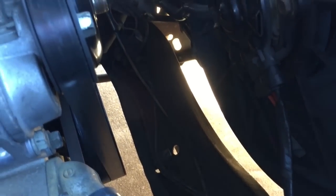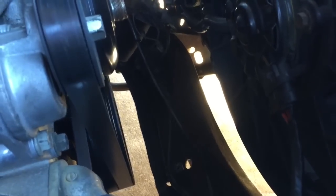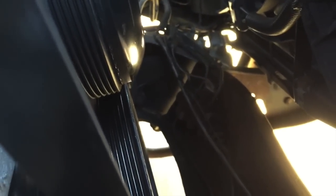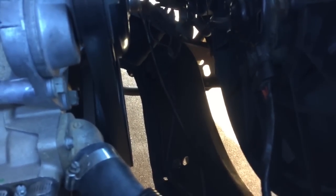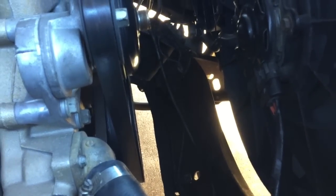After posting this on my Facebook page, someone commented that they make a reinforcement bar, usually for 4x4s, that goes over there and bolts to two of the gearbox bolts, and it's like a torque arm. It reaches all the way out to the center of this bar and bolts to that bar. I may consider either making one of those or seeing how much they cost, but it looked like a good idea to help reinforce that gearbox.